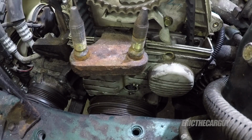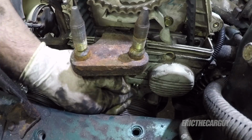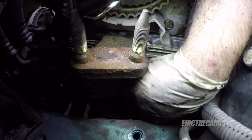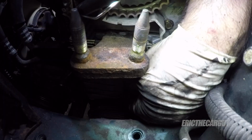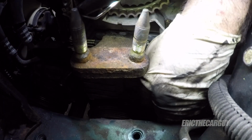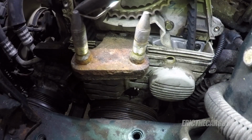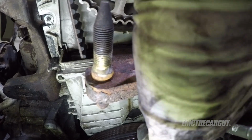You can then take your plug that goes over the top of that bolt and install it. Seems today that's easier said than done. Yeah, definitely easier said than done today. Usually this takes like 4 seconds. Today, 4 hours. Yay! I'm gonna try a little silicone spray, see if that helps. That did help. Yeah. Stay. Don't forget the other 2 timing cover bolts.